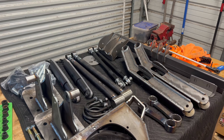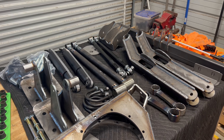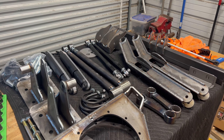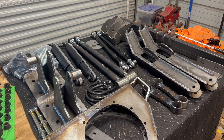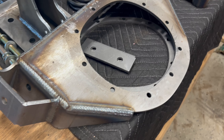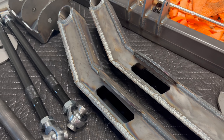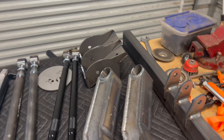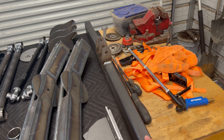Like we said, we're going to narrow the chassis and also have to narrow the gas tank cross member and move the saddles on the axle to make this kit work — that'll be coming up pretty soon. My buddy Brian's going to do all the powder coating for me, so hopefully it won't take too long once we get it mocked up. The kit did get rained on today sitting on the front porch when it poured down, but we'll see.